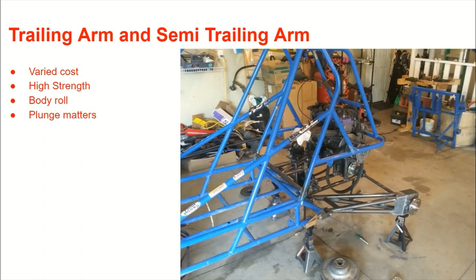So this setup is the trailing arm and the semi-trailing arm. This cart we actually made is our first cart, second time through on the rear suspension. As you can see, some of this has already been painted. As far as the cost goes, this can be quite varied depending on if you want heim joints on the end so you can adjust your toe if you don't build it perfect the first time. On this one we had bushings in here, so we can't adjust our toe directly. What we have to do is put shims behind our wheel bearing — it's a bolt-on wheel bearing — and you can shim it to adjust the toe.